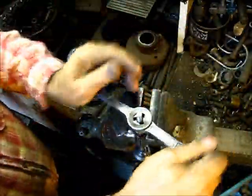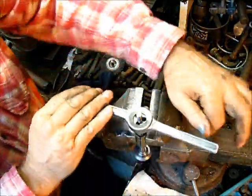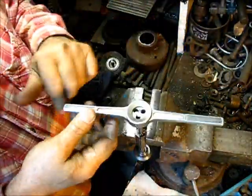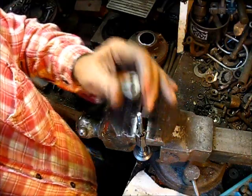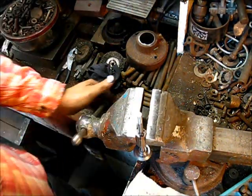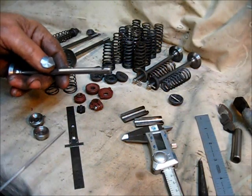I believe we got it — that's going to be enough right there. Put that lube on there and back it off. Now, on these cadmium plated nuts and bolts that are so popular today — let me make a statement: on these old engines, you probably shouldn't be using cadmium plated bolts. We'll talk about that a little bit later.